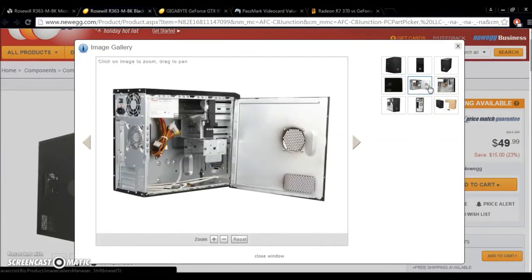And the reason that's one of the better things is that a lot of times what companies will do is there'll be a case company that solely makes computer cases, or at least doesn't make power supplies, and then they'll outsource to a super cheap Chinese manufacturer like Logisys or Raidmax or whatever, wherever those companies are made, and they'll just slap a white nondescript label into their case and say that they include a 500-watt power supply. Those are the power supplies you're going to be getting in pre-builts from things like Dell and Asus or whatever. The cheap Walmart pre-built systems are going to have those power supplies in them, as well as the cheap online cases that you buy that are too good to be true. The $25 case with a 500-watt power supply. That's what you want to stay away from.